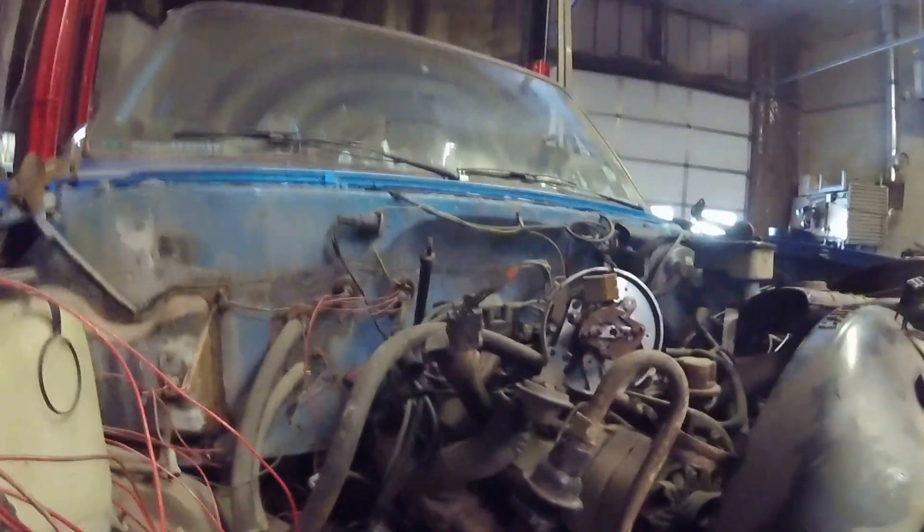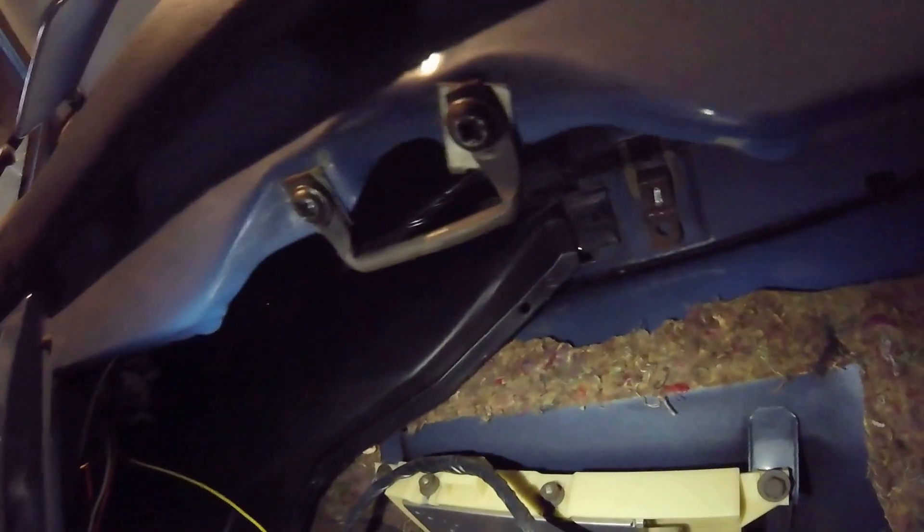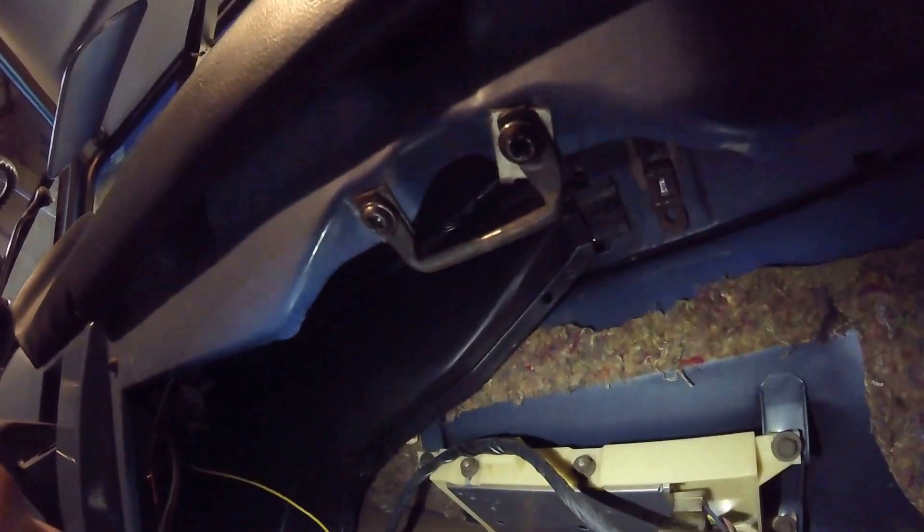So that was the problem with my Chevy 350 — no spark. I'll show you that computer box real quick here, right under the dash. I'll turn the light on. You can kind of see — let me turn another light on here. You can see way up back there, right there, that box. That's where that distributor wire went. Either that failed, or the part in the distributor failed. So we ended up bypassing that whole system and made it work with what we had.